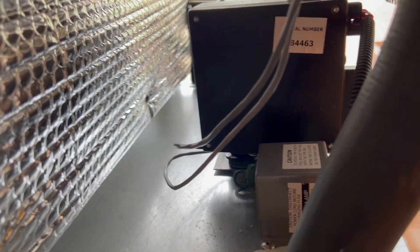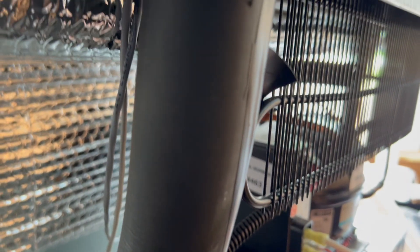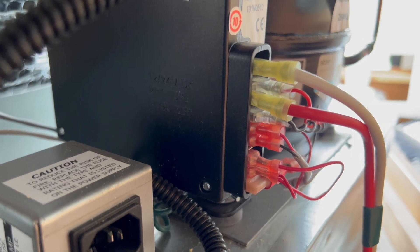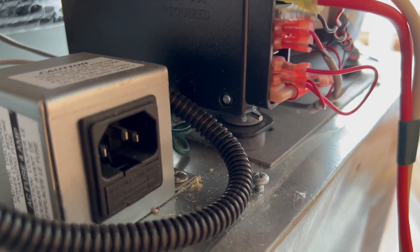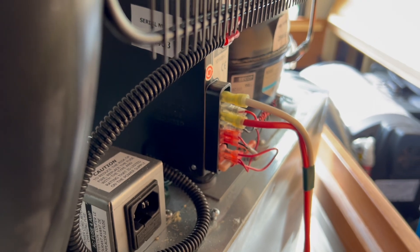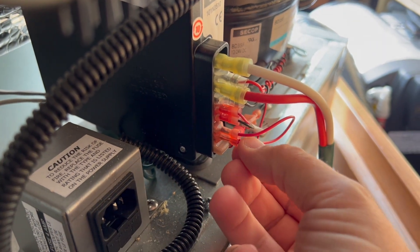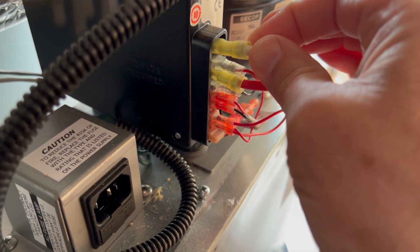This is the back of the fridge. You can see the power cable there and you can see it's just resting here on the plywood, so I don't see anything that should be holding me in. Next up is to remove this white cover so that we can detach the power cable and hopefully get to see the controller module. With that cover off, we can see the main components. My Winnebago Paseo was built in 2017, and this particular fridge was designed to work on either 120-volt or on the 12-volt battery system. When Winnebago installed this, they only used the 12-volt connection, and some have said that's why we can have problems with this module and it needs to be replaced. I've turned on the power and the fridge is working - the fan there is running. I called the folks at Novacool and they said to check for any kind of loose connections here on this controller board.